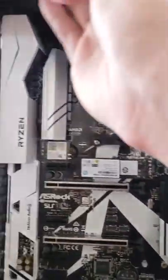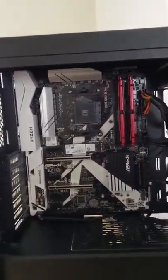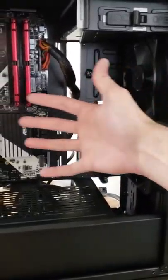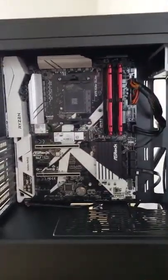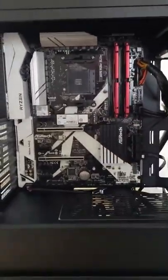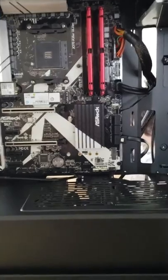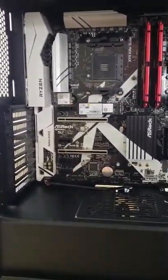Since it's a nice clean flush top there's no space for a fan up here, which I'm a little concerned about for heat — but we should be okay. I've got these good fans, plus a Cooler Master fan as part of the radiator, so these are high quality fans. I had to do it the opposite of most people — most people have air coming in the front and out the top, but what I'm going to do is suck air in from the back. Since I have two fans blowing out and one blowing in, it creates negative pressure, so the air is just going to want to go straight out — which gives cooler temperatures.